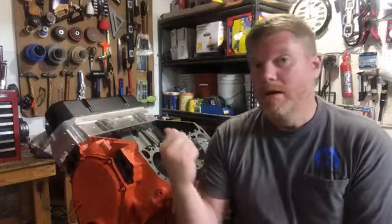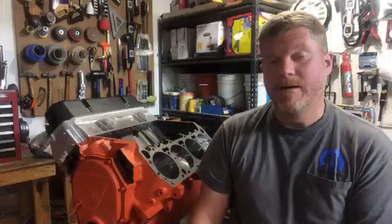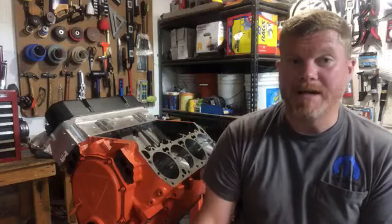I'm going to tune out because I think I've melted most people's brains when it comes to this engine stuff. I tried to summarize it as quickly as possible at the end. And yes, on a modern four-stroke with a knock sensor, you can run 87. It'll get you home. It's not going to be happy. It's not going to run at its best. It's always happier with better gas. Don't be cheap. But it'll get you home. You're not going to hurt your motor. And anything with ethanol, it's negligible. It really is.